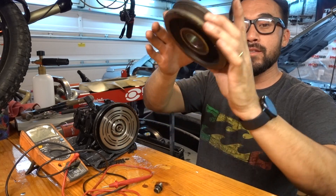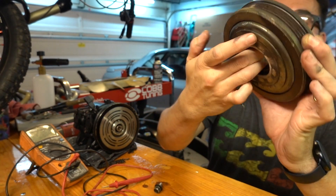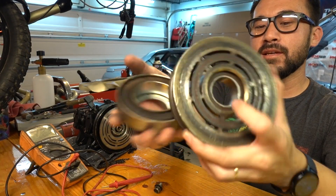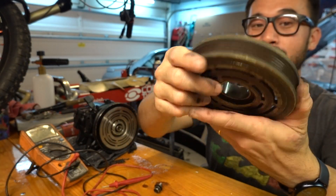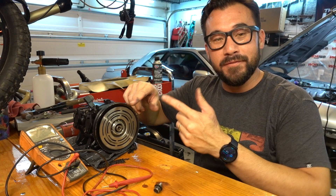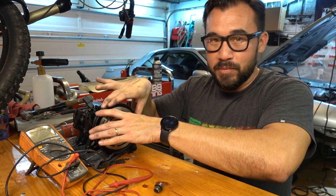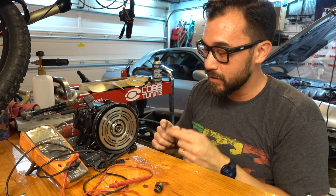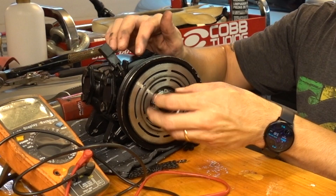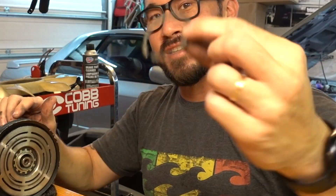Here's the Skyline pulley - this is what it looks like behind it. Sometimes the bearings in here go bad and you need to replace those - they're really easy to replace. You can just hammer them out with a socket and hammer a new one right in. Things get a little bit different depending on what car you're working on. The way this pulley mounts to the compressor is probably different in your car. The way this one works is with a locking ring that I have to loosen up. Here's the locking ring. Most cars use a snap ring - you need snap ring pliers to get it off.